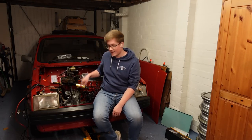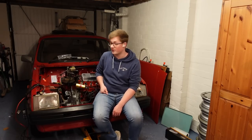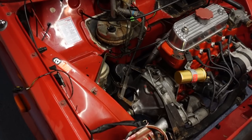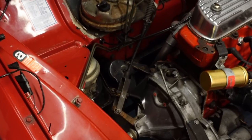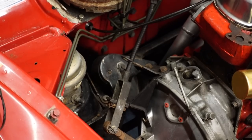So what I'm going to do - and I'm not going to film this because this video is already going to be really long - is jack the engine up as high as I can, take that engine mount off the subframe, and swap to the original because there is definitely something wrong with that engine mount. Back in episode four I mentioned that one of the mounts I bought wasn't genuine, so here's your warning: if they're available, buy genuine parts, and if they're not, hold on to your original parts. I've already been stung by non-genuine wheel bearings from one of the premier mini part suppliers failing after less than 1,000 miles. As your nan always used to say: buy cheap, buy twice.